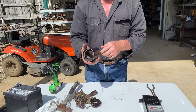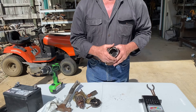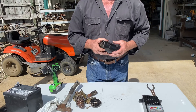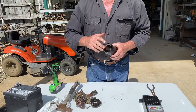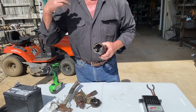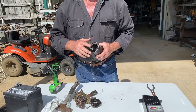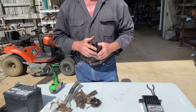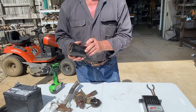What I want you to do is take the spark plug out of it and turn it over. When you turn it over with the spark plug out and you don't have any compression or resistance in the motor, it's gonna let you know a lot. It's gonna let you know if the battery is weak; it's gonna let you know if everything on the inside of the motor is all right — like a rod being out of adjustment. It tells you a lot just by taking the spark plug out of the motor and turning it over.